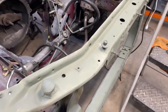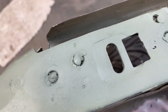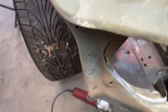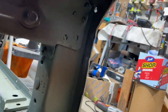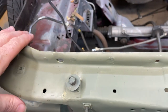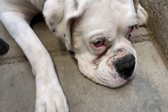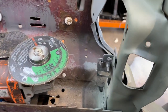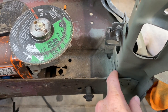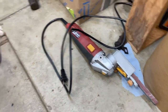There you go — it is all installed. They might not be great but we ain't professionals here, so it'll hold and it's solid as hell. Got the etch primer on here to keep it from rusting, and I've got all the stickers that were on here off. That sand rack made quick work of it — when we had to sand out the inner parts of these to weld and get all the rust off down to bare metal, that's the only thing we could get in there. Get yourself one of those, they're cheap and they work great.